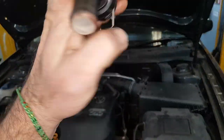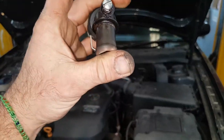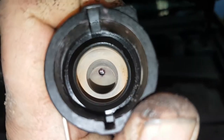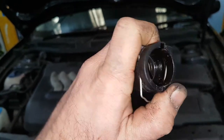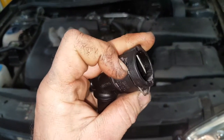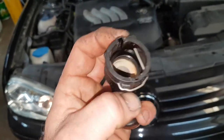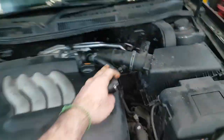When removing it, much like the bore video I made and the Mercedes-Benz radiator video for the oil coolers, the preference is to actually remove the clip. What happens is you can't really see it and it just moves — see that — and the hose won't come off, or you'll shear off the thing. As you can see, if it moves it's not going to come off. For the first time yesterday I didn't remove it here because this cooling system's coolant red powder stuff was seizing the clip up — it took me half an hour just to pull this clip down.